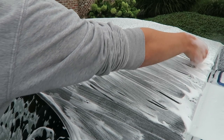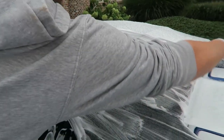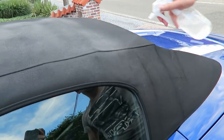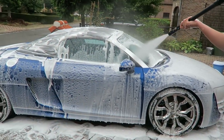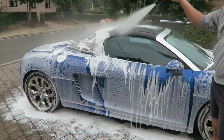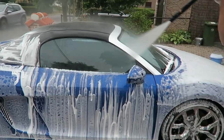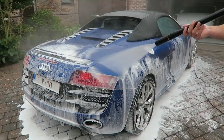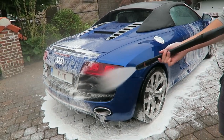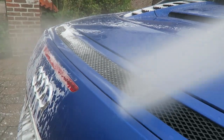In the foaming stage I also put some foam lightly on the roof, starting there. I don't do convertible roofs very often, only like once a year, but I was going to protect it afterwards so I did want to get it thoroughly cleaned first. I instantly rinsed the roof because I don't want the soap sitting on it for too long — it was on there for like one minute, I agitated it, and then fully rinsed starting with the roof. As you can see the roof is really wet, it doesn't repel water or dirt at all, so it really could do with some protection.